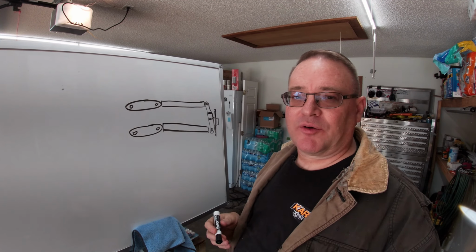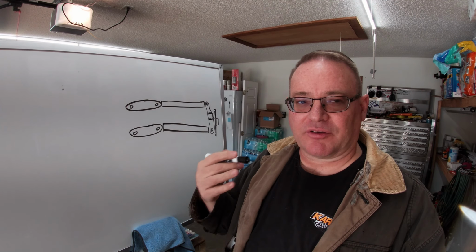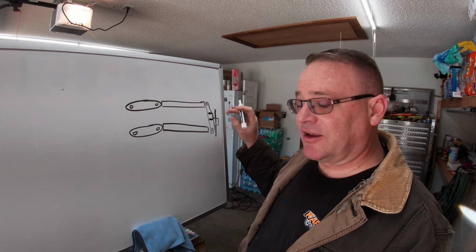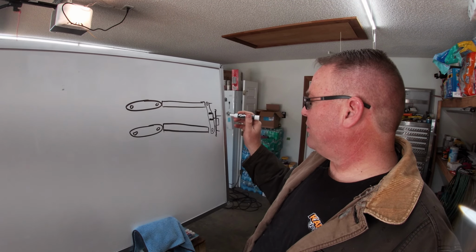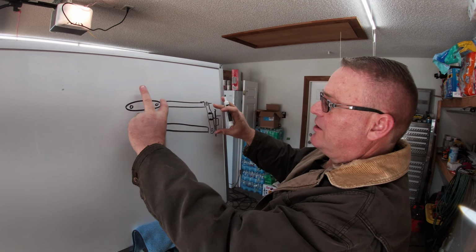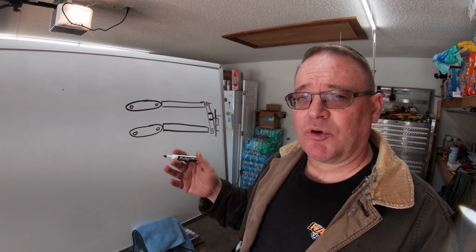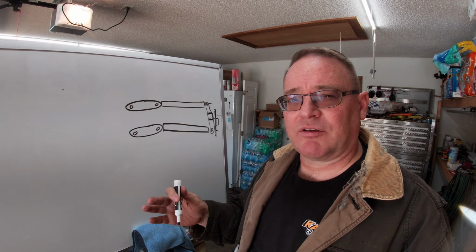One of the things that I'm working on is the reason why I needed to get a steering rack in order to finish up my bulkhead is because I need to know where exactly to mount it, right? So here's my knuckle, and this is where the tie rod mounts to the knuckle, right? And there's measurements, so to speak, up and down. I want all of my links to be parallel, so as they move, everything moves together. And one of the reasons I wanted to make sure that I had my steering rack when I did the bulkhead was because if I mount it in the wrong position, it won't work with the A-arm suspension.